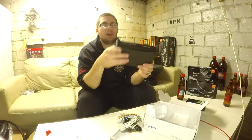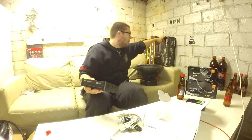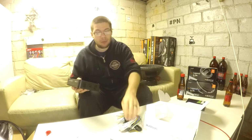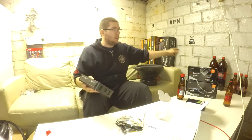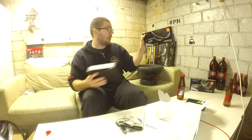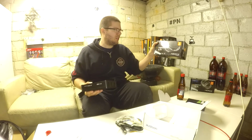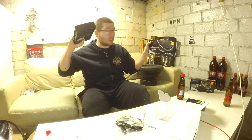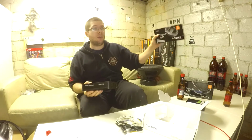Now with this you can drive, let's say, a fully active 3-way front end with an external subwoofer amplifier. For example, you can put Hertz Mille Legend speakers on 2 channels bridged. So you can actually bridge these channels to get 130 watts per mid. Then you can put, let's say, Hertz Mille Legend ML700 on 2 channels, 35 watts per center speakers, not tweeters, well, mid-range speakers. And then you can have 2 channels, 35 watts for tweeters.